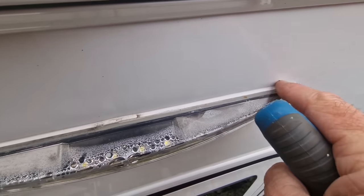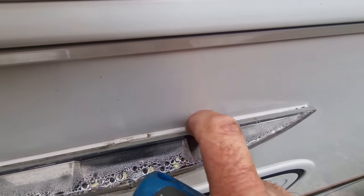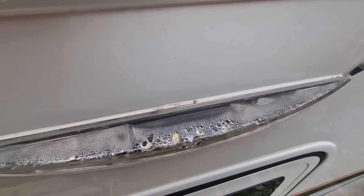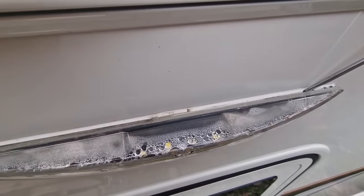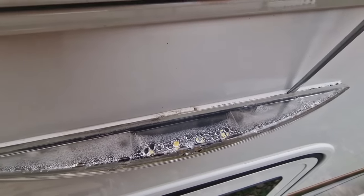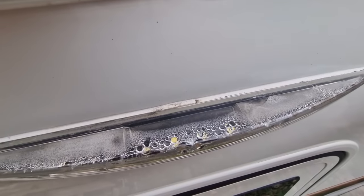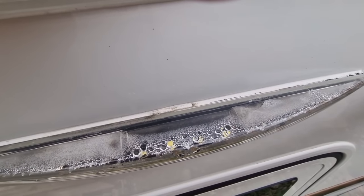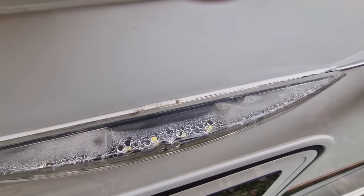As you break that seal down you'll see that you can work it down and it'll start coming off. Fishing line will sort of cut through nicely. Another way is with a Stanley blade — just a few different ways and you'll figure out what is easiest for you. If using a screwdriver, be very very careful because you can damage the aluminium skin very easily, so it's not really advised, but if that's your only option just go very very slowly.